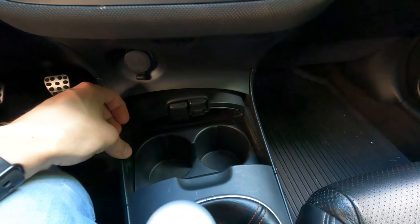So we've got everything on the front off. This piece pulls up after you take the shift knob off, and then there are two bolts here. You take off the cigarette lighter plate and then unplug it. Then these two screws, and that's all for the front.